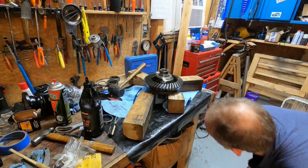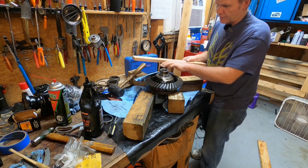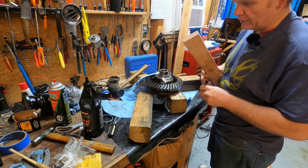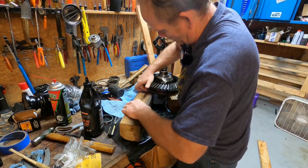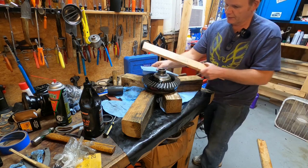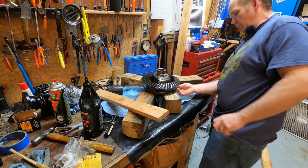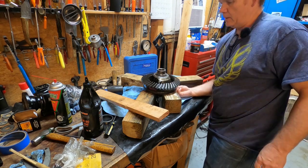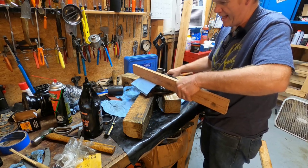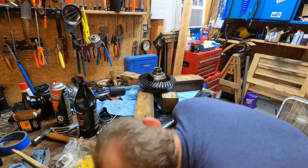All right, we've got some four-by-four action going on here — this might do the trick. I cut the scene there. This is kind of a touchy process, but I've been banging on this thing for several minutes and making some progress finally. Yeah, we're coming on down now. It kind of makes me wonder whether I couldn't just put the bolts in and draw the ring gear on with the bolts. Our alignment pins are moving freely, so that's a good sign — we should be aligned. A bolt lines up. We're almost down. The rag is to keep the sawdust out of my differential. And I believe that's it. Let's flip it over and put some bolts in it.